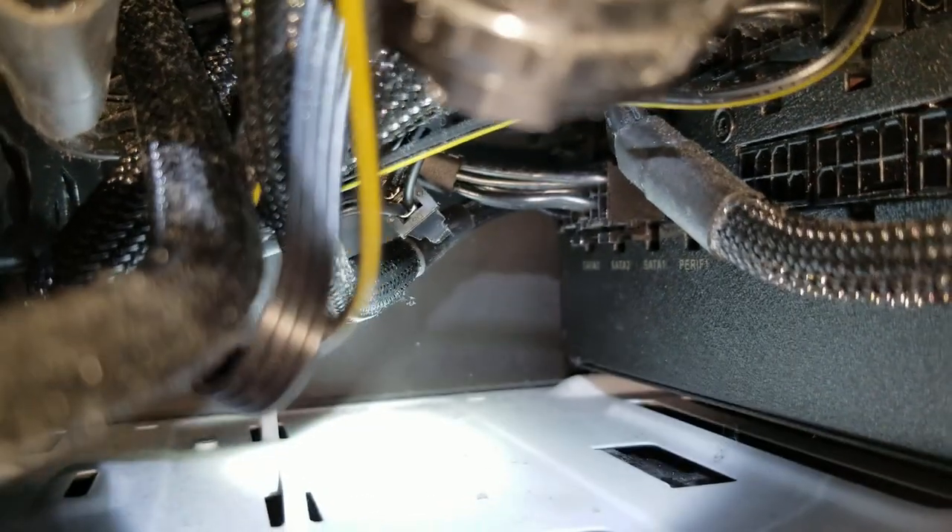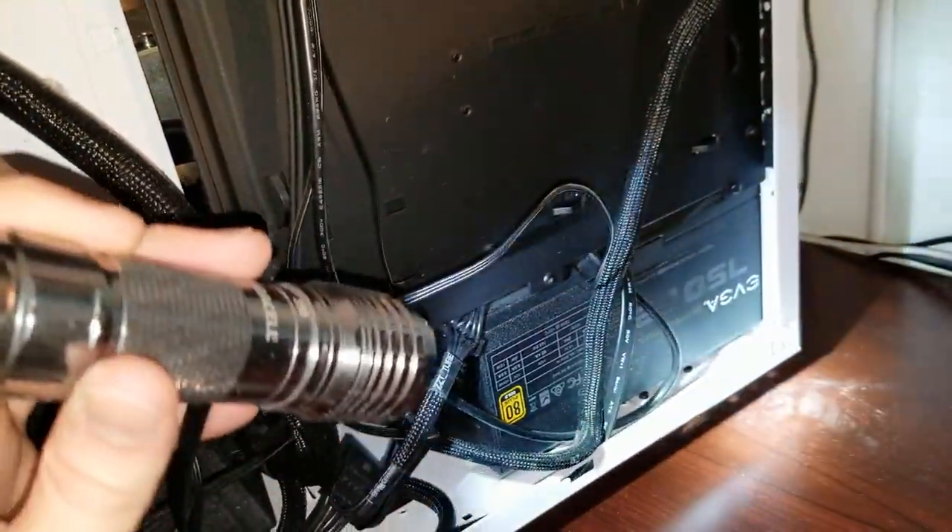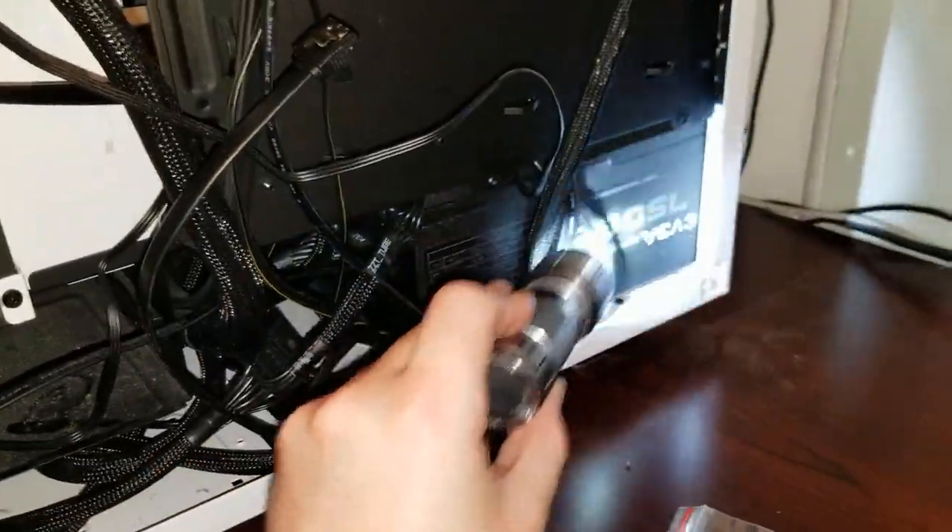Alright, now I'm going to get this power cord plugged into the PSU. This cable needs to go really far back — it's a little tight but we'll get it done. I can see SATA 1 and SATA 2 back there, so I'm going to plug into SATA 2 and make sure it's seated tightly. Then I'll shove these cords back. Now for the SATA data cable — I decided to route it above the drive to the motherboard port, and it clicked in without too much difficulty.